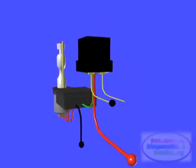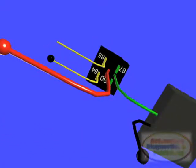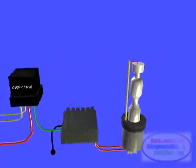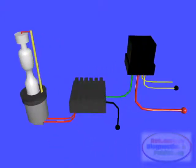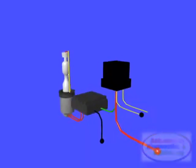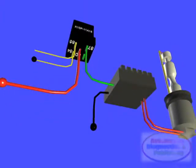By powering the ballast through a relay, straight from the battery to the HID ballast, the heavy load is removed from the stock headlight circuit. Triggering the relay only requires 0.1 amps, so the stock headlamp circuit has no problem powering that. A relay is just a remotely mounted heavy-duty switch, and the trigger power that goes to it just draws a small amount of current through the headlight switch to run an electromagnet that mechanically closes the contacts inside the relay. This in turn hooks battery power straight to the HID ballast power terminal. This ensures that you won't ever overdrive the ratings of your vehicle's harness.